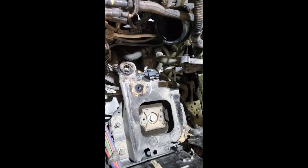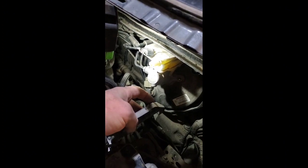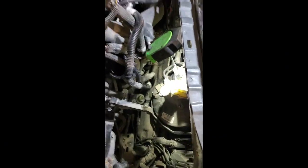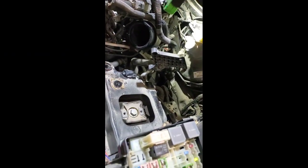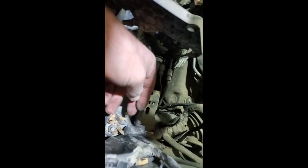So far where we're at: I took the battery box out completely. There's a screw you have to take out here, and a little plastic popper thing comes out — it kind of auto-centers itself. This next part I kind of glaze over because I was under the impression the relay center had to come out, which it does not. That whole side stays in. The wiring is kind of confusing if you don't know what has to get unplugged and what goes with the vehicle versus what has to get unclipped — I figured that out along the way.